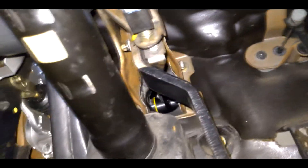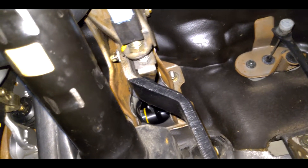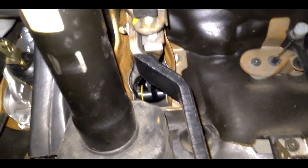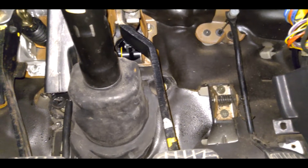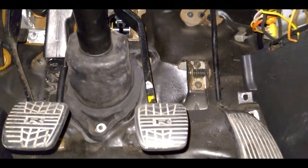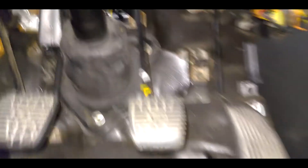Here is our brake pedal. We'll follow that all the way up — you can see why we didn't do a tutorial video. It is very tight and hard to see up here, but basically we have modified the fulcrum point for the pedal. That changes it from the factory 4 to 1 ratio to 5 to 1. Anything less than 5 to 1 we found is no good for a non-boosted setup, so ideally you want to go above 5 to 1. According to the experts, about 6 to 1 is probably the best. Currently this is sitting at a 5 to 1 ratio.